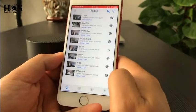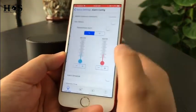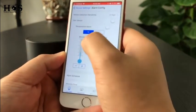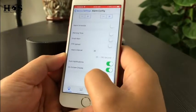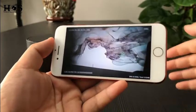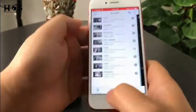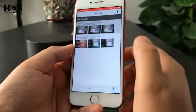The camera also has a motion detection alarm function. Let's go to the alarm setting: press the gear symbol, then device setting, and select alarm. In the first line you will see the motion detect sensitivity — you can choose high. You can also set a gas sensor detector, temperature alarm detector, and alarm tone. Remember to press OK to save the setting. Then go to the live video page. If there is motion detected by the camera, it will send a notification with three pictures. On the first page when you check the alarm you will see three pictures of the motion. This is the alarm function.